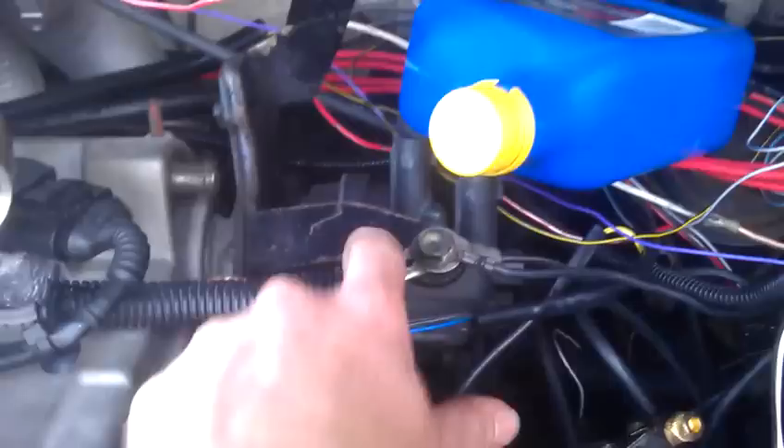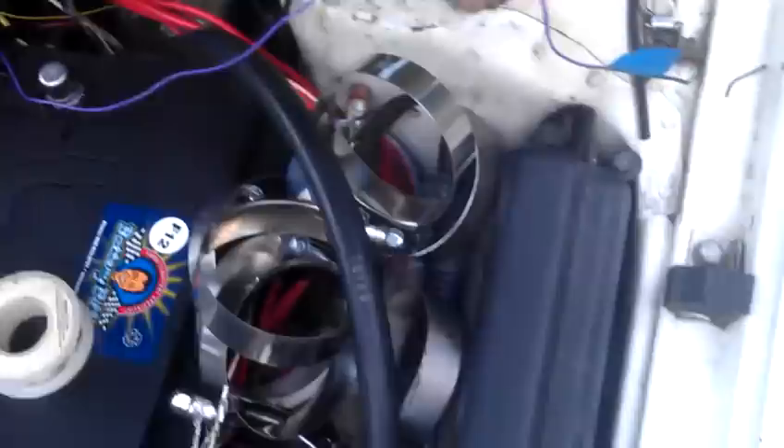The individual coils — all the wiring is run. This is one ground point for the coils, and the little ground wires are for the individual igniters on top of each coil. I've got a fatter ground wire bolted in as short as I can make it to the closest ground point. I ran four individual ground wire extensions all the way to the closest grounding spot. I did the same with the power wires — four 10-gauge wires from each coil all the way over; those are these four fat red wires. I'm going to have each one going through a different fuse.